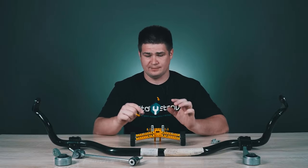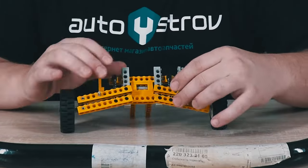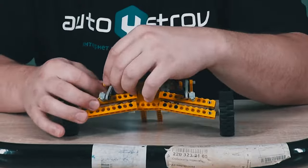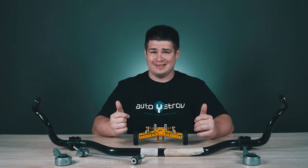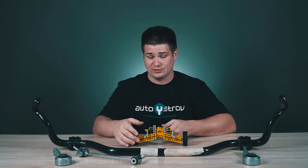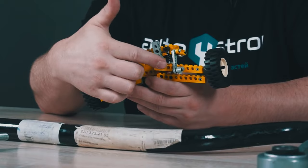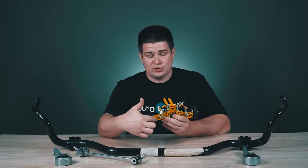Now I will add the anti-roll bar to my suspension model. Finally, I assembled the entire anti-roll bar on my suspension model. Until I installed this bar, the suspension was independent and each wheel moved independently of the other. Now, due to the sway bar, these two wheels are mechanically connected. This control arm through the vertical part is connected to the sway bar and there to another control arm, and everything now works together at the same time.